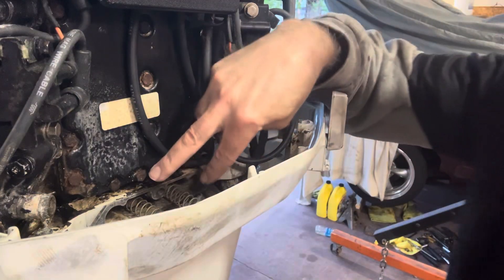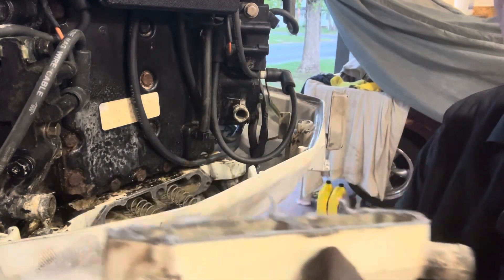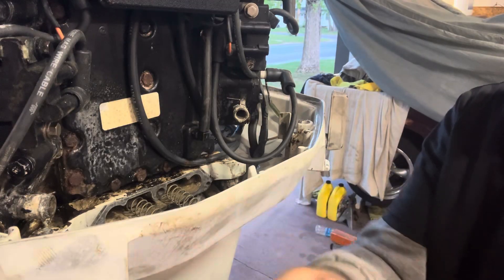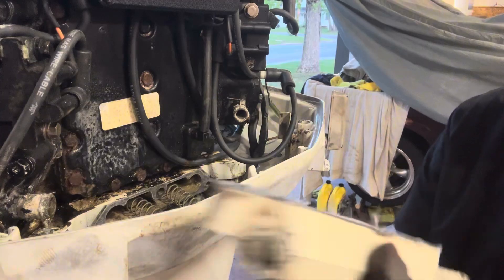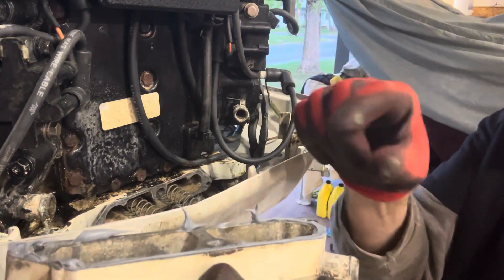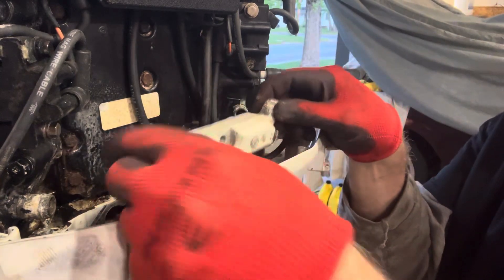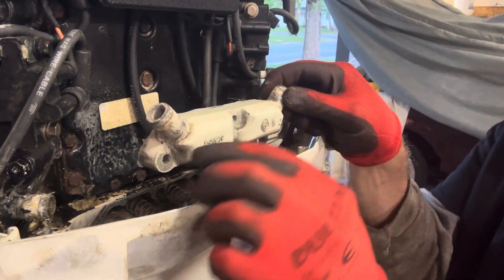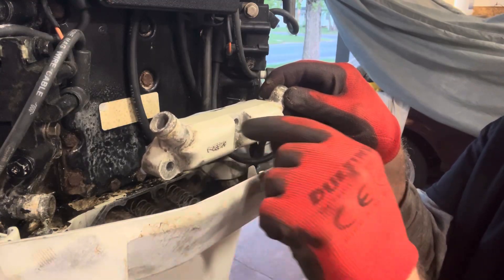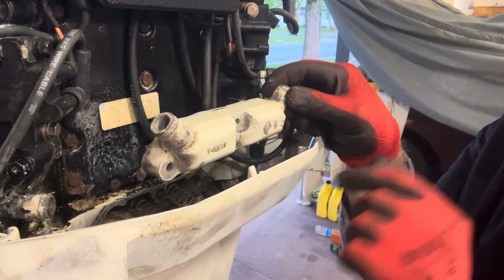You can see we have our two springs in here now ready to go. We cleaned up this surface. I'm going to do a thin layer of sealer, spread it out really thin, put my gasket on, then put a thin layer on the other side, put our piece in, put a thin layer on that gasket so it's ready to go, and then we're going to feed this in here with the bolts. I have a really thin layer of grease on all the bolts including the holes and the shaft so they'll come out better next time.